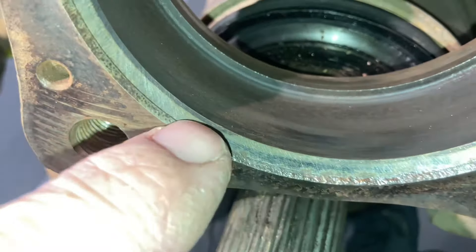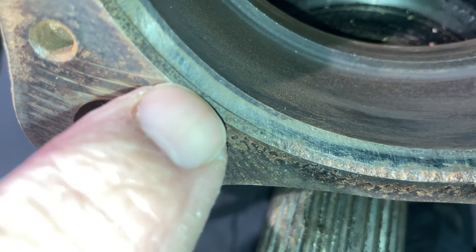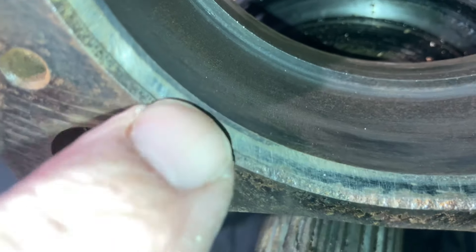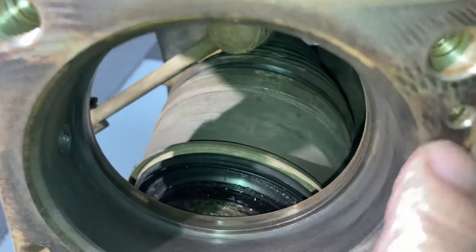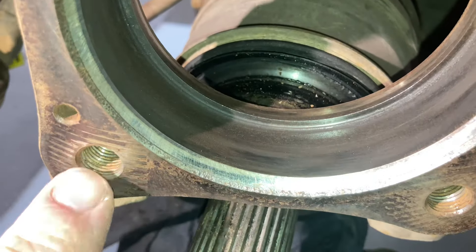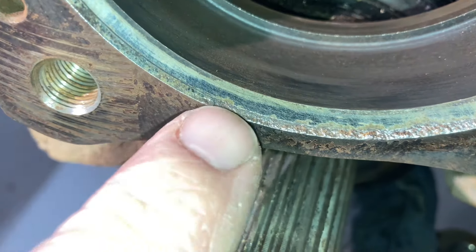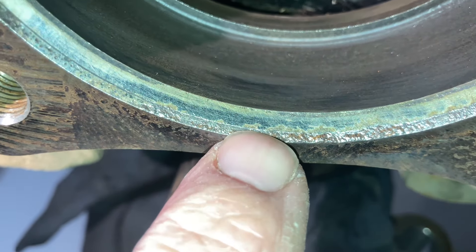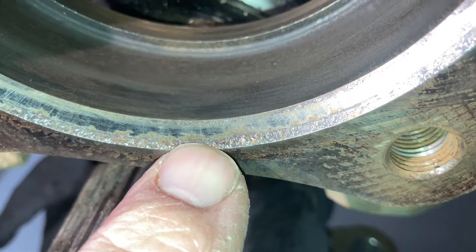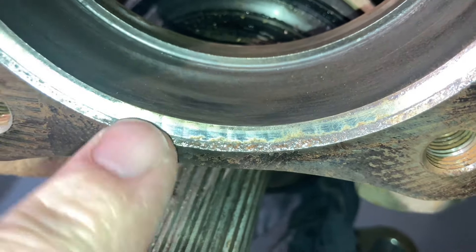See that really clean area there? There's a chamfer — that angle — and you've got about two millimeters, then about three millimeters where it's clean and one on the inside. All that matters really is that three millimeters in the middle, because that's right where the O-ring sits. Tech tip: put copper grease on the face here, put some grease on the O-ring, so when it goes in, if this area is full of grease, it's going to help seal and keep the water out. Because once the water comes in, you can see it's sitting at the bottom in the corrosion — that could slowly eat its way in. Grease in here so the moisture won't get in and the grease will help with rust prevention.